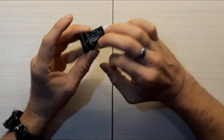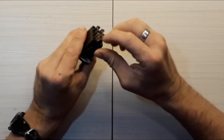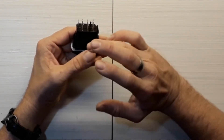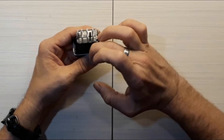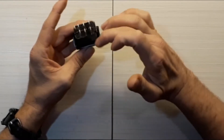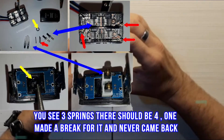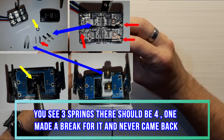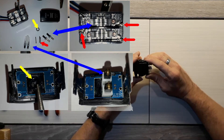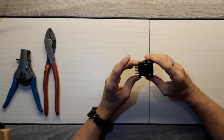You want to be careful when you hook these things up not to separate the bottom part. If you start messing with these little clips on the ends and pull them out, the bottom part of the switch will come off. Inside are a little O-ring that sits on the post, the actual toggle for the switch itself, and two rockers underneath everything. The rockers are what actually make contact with the post when the switch is connected. If it falls apart and you're not ready for it, shoot me a message and I'll give you some pictures on how to put it back together.